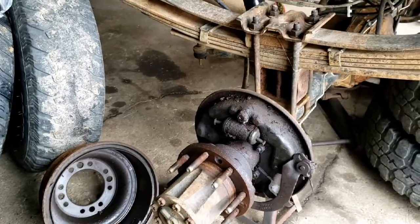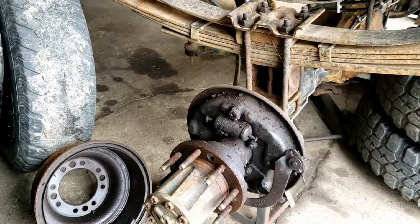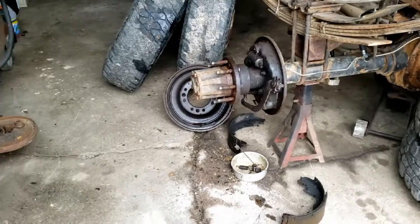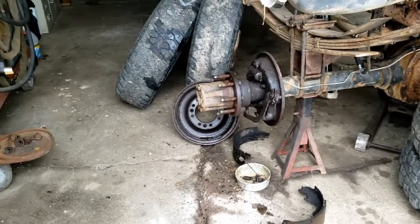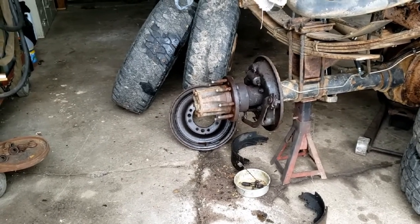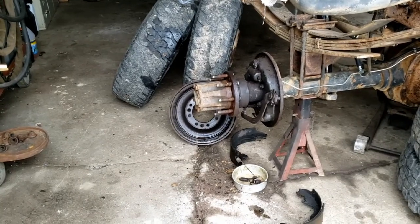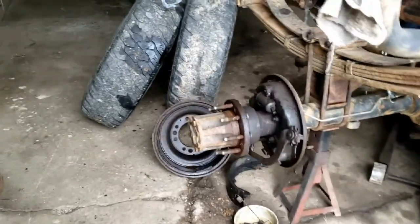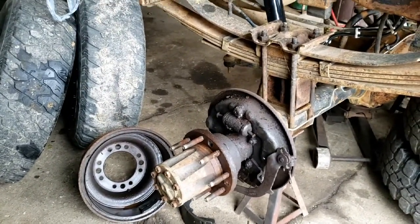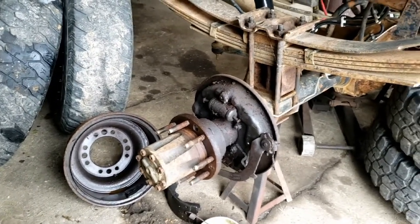So the self-adjusters, the spring pack, the hardware kit, I think they call it, that kind of stuff, they usually just rake you over the coals. So I placed an order with Rock Auto. I'm getting Bosch brake pads, Wagner parts for a lot of the stuff. And I think I've got $93 wrapped up in this brake job. And I'll be replacing everything that is replaceable. Both wheel cylinders, pads, the hardware, the springs, the self-adjusters, everything.